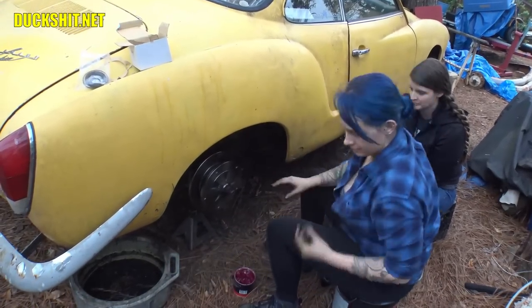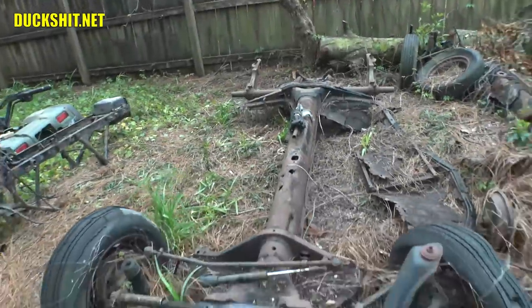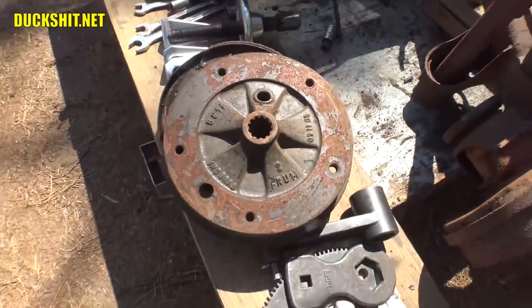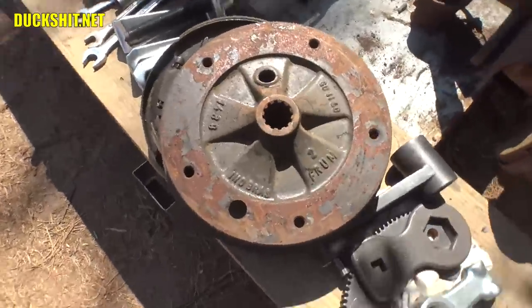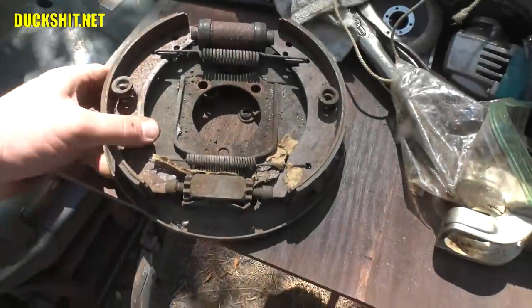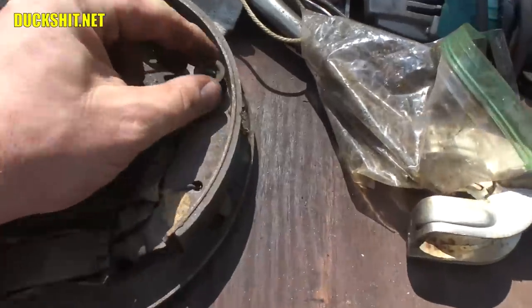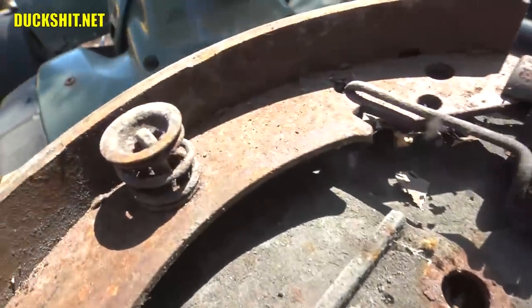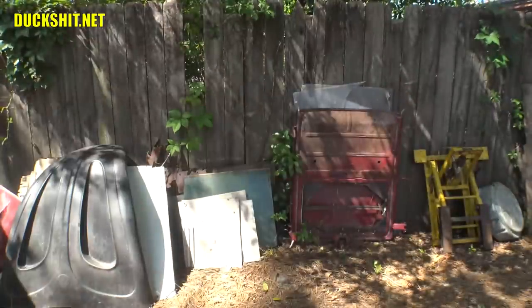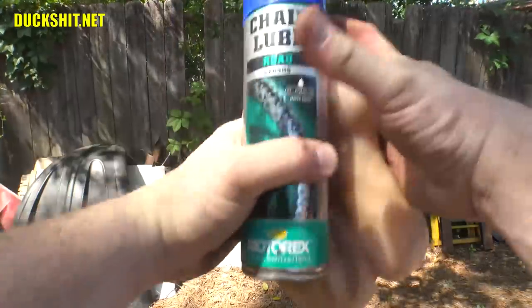What if you don't want to buy an entire disc brake set? The conversion doesn't take much if you already have the parts laying around. You'll need a pair of 5-lug drums. You cannot put your 5-lug drums over your late-model backing plates — the spacing is all wrong and the brake shoes are too wide. Even if you swap out the earlier shoes, the spacing will still be wrong, and when you torque the hub down it will bind, or worse yet something will get crushed and break. Don't destroy your old brake parts — you can probably sell or trade them and recover some of your costs.